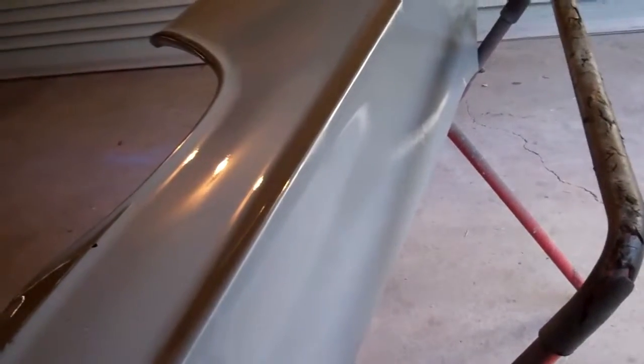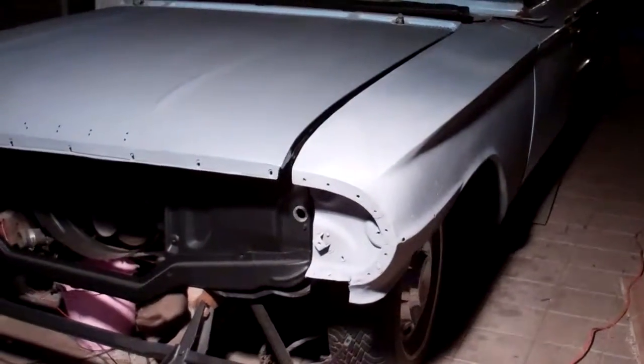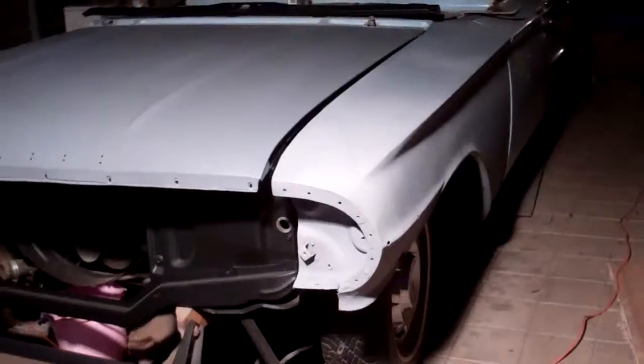There are a few coats of edge primer going on there just to protect the guards from rust while I continue on the bodywork and on these fenders. Both guards have been patched up and edge primed, back on the car just temporarily so at least they're protected from rust. All the major rusty parts have been cut out - there's still more work to do, and there's going to be a lot of bodywork to fill up those seams from joining the two pieces of fender together, but they're slowly coming along.